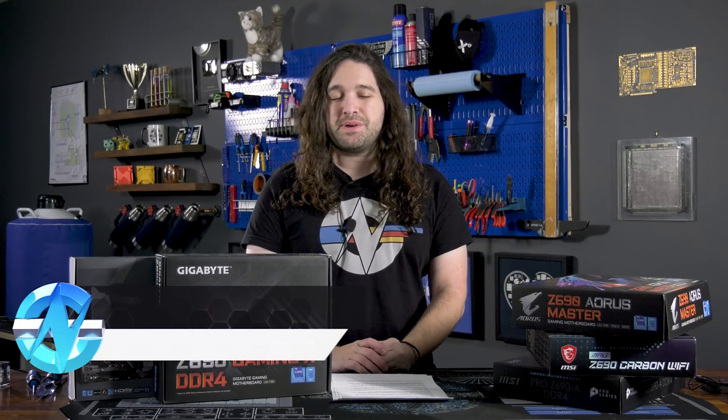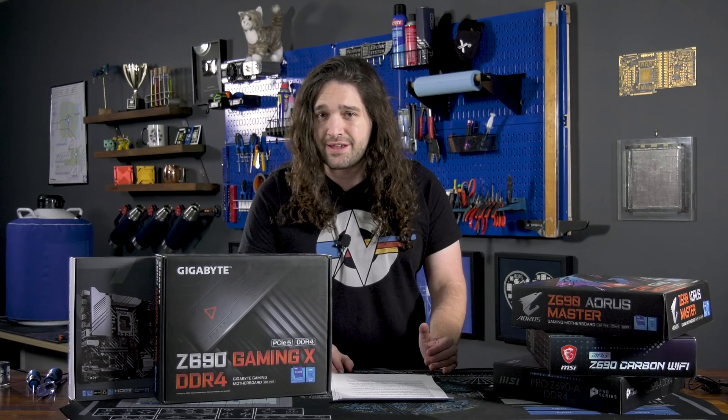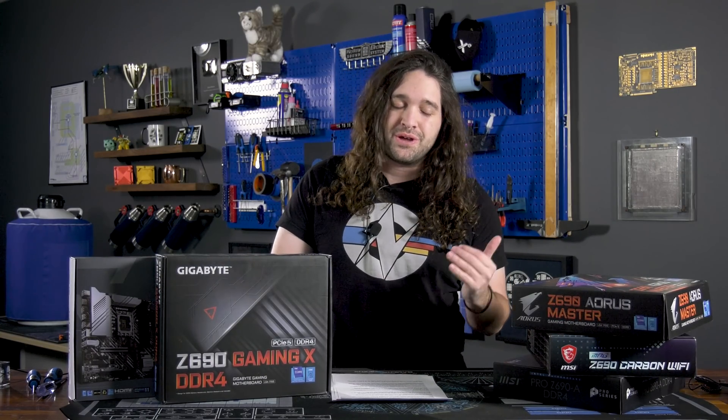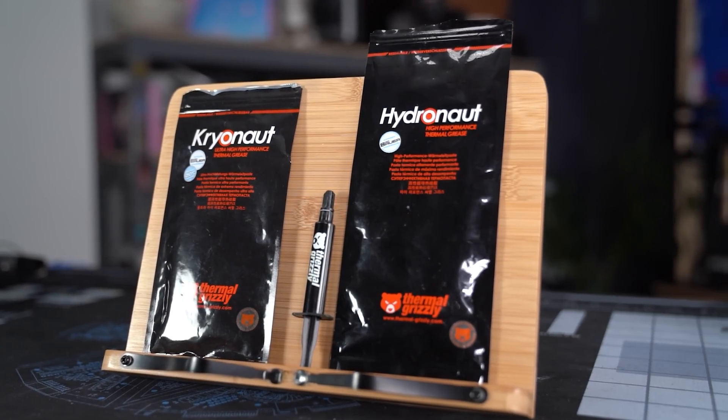This isn't exactly a hot take, but paying $240 or more for a B660 motherboard is generally a bad idea. In this video we're going to walk through the chipset differences between Z690, B660, H670, and H610 — Intel's chipsets available for Alder Lake CPUs. The goal is to provide the firm spec differences, explain what the chipsets do, why they're different, and to what extent that difference might matter for you. We'll also go over where you can potentially save some money in a way that won't be a $240 B660 board, because then you're just going backwards.